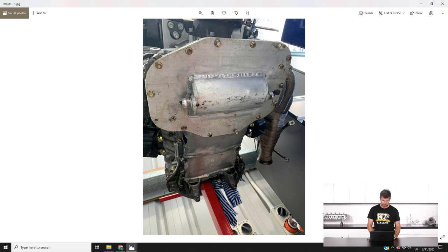Just looking at it head on there, we can see a nice little hole there showing some of the carnage we've been dealing with. It's pretty basic - the fabricator that built this car originally basically made up this aluminium laser-cut plate that we've got here, and then it's just got this lower section which acts as basically a bit of a sump for the oil to drain into, and then we've got a dash-10 AN fitting on both sides of that.